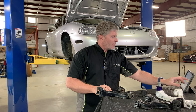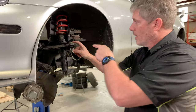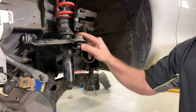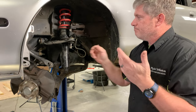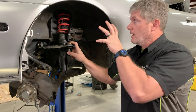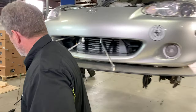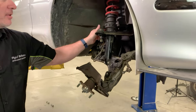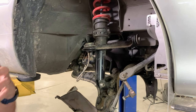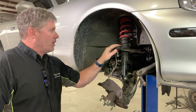I'm going to show you on the car what I mean about that spring rate. This is a factory upper control arm — we're in the middle of doing an install on this car. There's the factory upper control arm with a rubber bushing. You can see if I push this down, it goes right back to where it was — that's the spring rate I was talking about. That's not necessarily desirable; it fights the suspension moving a little bit and also affects the spring rate you choose for the car. On this side, this one is mounted with the spherical bushings, and you can see it stays wherever you put it. It's not floppy, because you want these bearings to be fairly tight, but there's no spring rate on this at all — it will have no effect on the movement of the suspension.